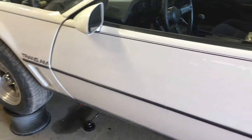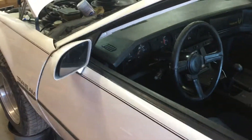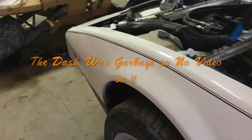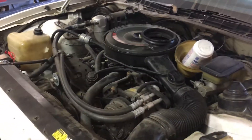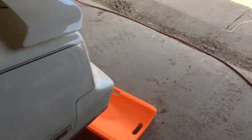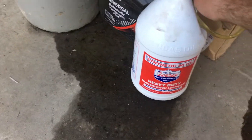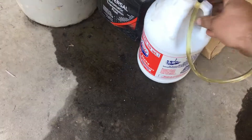This car is going to become a little fun driver. I did order the digital dash for it — the blue digital gauges — so I'll probably do a video on those. Right now I'm just changing oil and I changed the transmission fluid too. It had regular ATF in it, so I went ahead and put what Tremec recommends in non-world-class T5s: synthetic 50-weight.